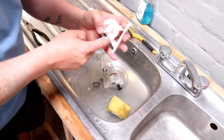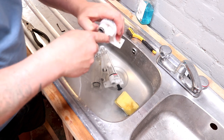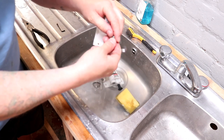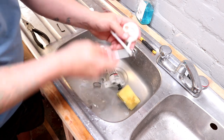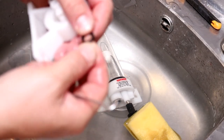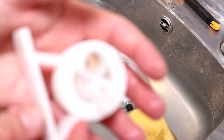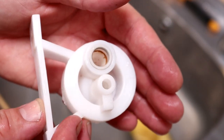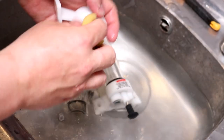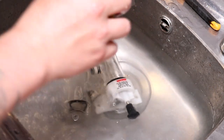Underneath, we can pop out the John Guest fitting. You just have to be careful you don't snap this section — the little bit of plastic comes out. We'll give that a clean in a minute. Then in here we have another O-ring. Give him a clean on the side. And then in there you can see we've got a little bit more crud on the inside. So we're just going to get in there with a bit of screwed-up sponge, or if you had a little nylon brush, that would be sufficient.